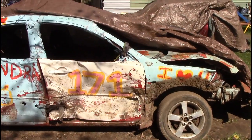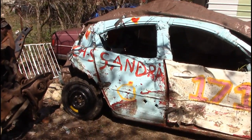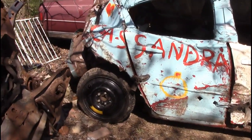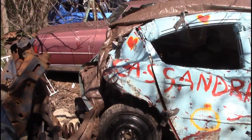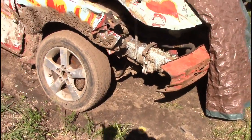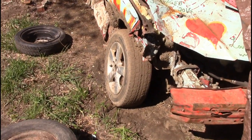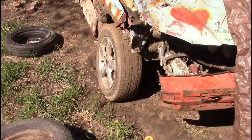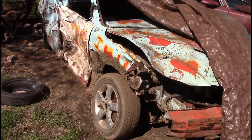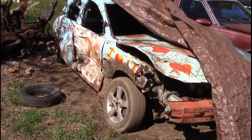Now this Mazda — basically nothing has broken to the point where it's going to cost me any money. It's a beat, broken, and bruised car; the back of the car is pretty much gone. But all that's wrong is a bent strut and a bent tie rod. I can fix the strut by hooking a winch cable around it and pulling it straight against the trailer, and you guys have already seen me fix the tie rod — so this has cost me nothing and only took about 30 minutes.